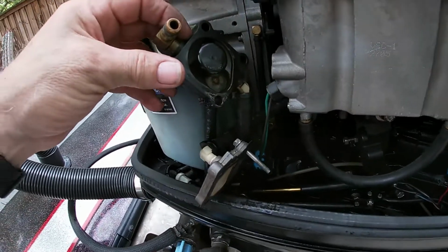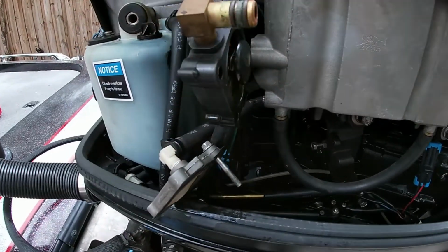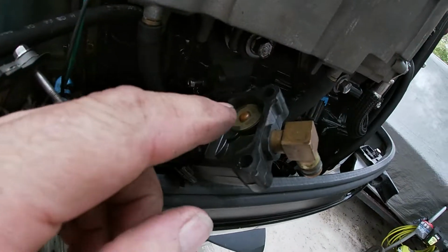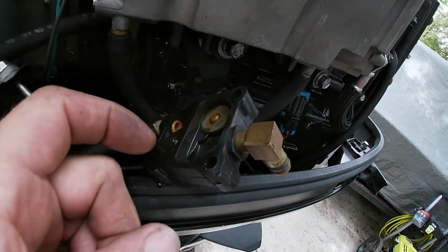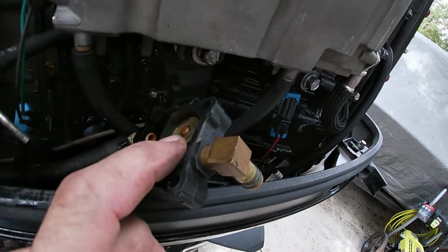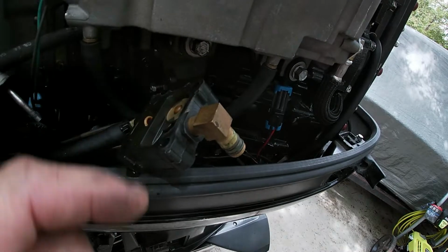Okay, as you can see here, see these little springs that the diaphragm bounces against. That's there so the spring doesn't tear a hole through the diaphragm. Then you have these little one-way diaphragms down here on each side. So it creates a back and forth action. So it pumps it in one. And then as the pulse happens, the diaphragm bounces off the spring and sends it back up into the next diaphragm, which is here. So in, out, and this goes into the VST tank.